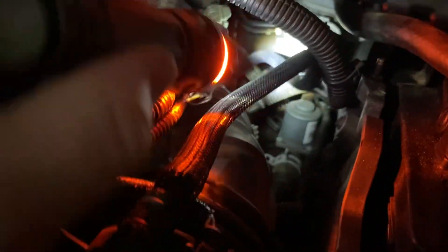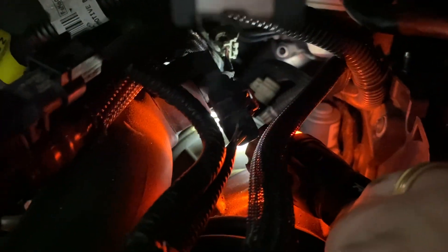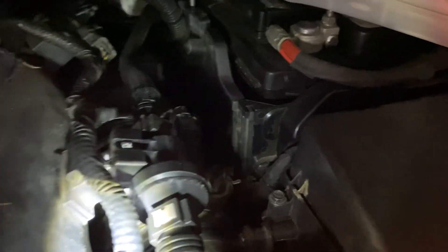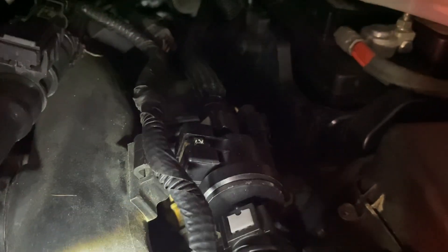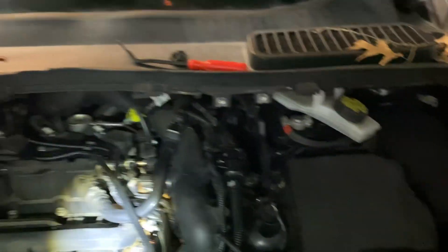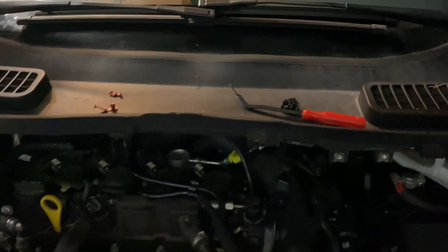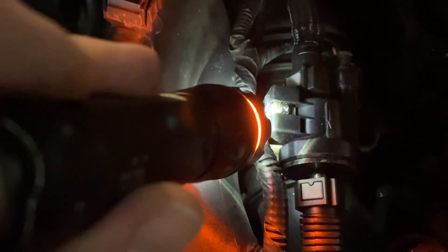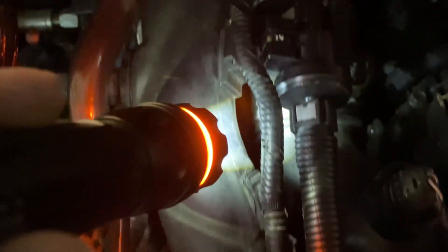I am trying like crazy to get a good picture of this. I don't know if you can see this, but I assure you it's back there. This is way underneath the cowl, behind the power steering reservoir. So after you disconnect all four of those — including the one going to the top of the valve cover — just reconnect them with quick disconnects. Should be a done deal after you unplug the power and transfer the mounting bracket from the old one to the new one.